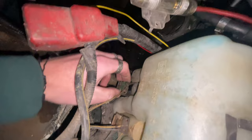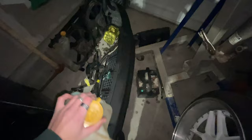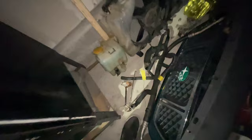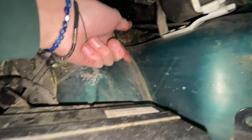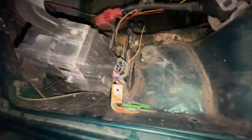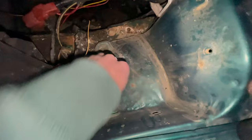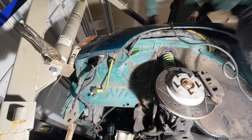We'll take the wheel off because it's better to cut from underneath. We also got to get the pumps unplugged — everything disconnected. We're leaking a bit, going to set that up so it doesn't leak. We'll start back here, cut along the side of the tower. You don't want to go too far up because it's structural — just barely on this — that way you get the whole thing out without losing any structural integrity. I decided to move the fuse box because some of the wiring was a little too close for comfort.